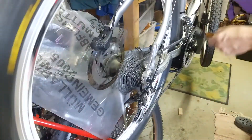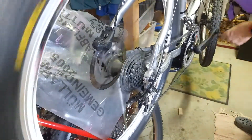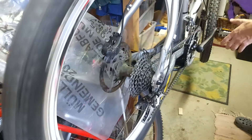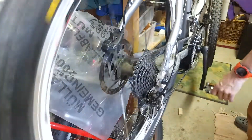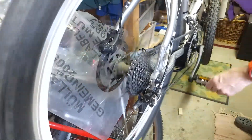Downshift works very well, and shifting up — middle position, upper position — works reasonably. The chainline is also no problem. If you experience problems shifting to the large chainring, use the stiffness of the chain. This means on the rear side, go to larger sprockets. Now it more easily moves to the large chainring, and then go down on the rear again.